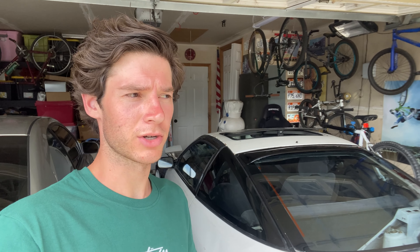Welcome back to the garage. In today's episode we are once again chasing exhaust leaks on the 240. We've fixed probably one or two exhaust leaks already, but there is another one. I'm thinking it's somewhere around the muffler area, which also happens to be the part of the exhaust that I drag getting out of the driveway — it's the lowest part. So today we're going to jack the car, get underneath, and see if we can knock out more exhaust leaks and further improve the exhaust tone on the 240.